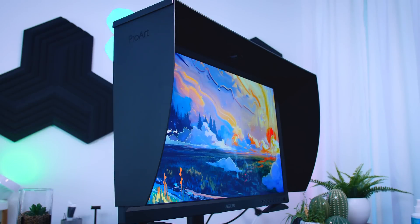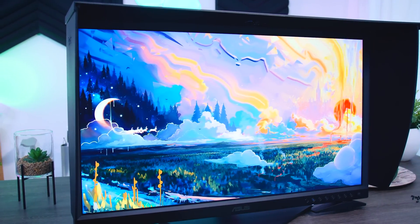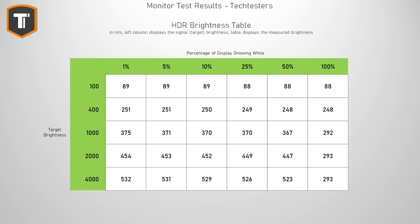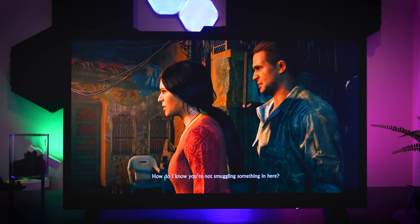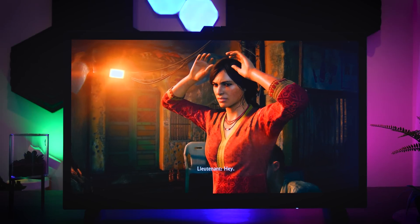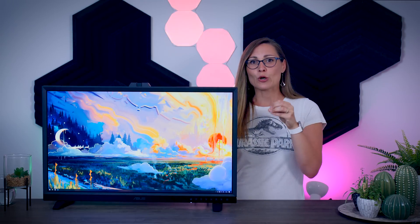You can use the included hood to lessen the light reaching your screen, but the best thing is to just make sure the room you'll work in is not too bright. Since this RGB OLED panel doesn't have that extra white pixel in its layout, switching to HDR mode doesn't really make it go brighter. The HDR image is very consistent in color and brightness tracking, which does give it a pretty perfect image. But it doesn't offer those extra bright peaks that you get from QD OLEDs or mini LED alternatives. Keep in mind, this is still going to be one of the nicest-looking HDR images you can get in terms of color and accuracy, and it is still very bright — it just doesn't have those super bright peaks.